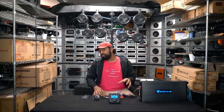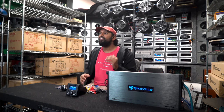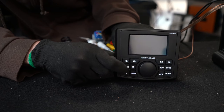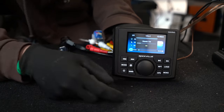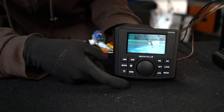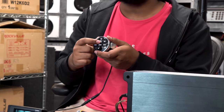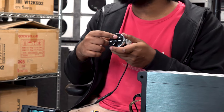One of the cool features is video inputting and video outputting. It's important to know how to switch between music modes and video modes: first go to USB mode by pressing the mode button. Once you're in USB music mode, if you want to switch to USB video mode, just press the band button and it will bring up video. A quick note about the remote: to play music you hold the button, and to change the mode you lightly click the mode button.